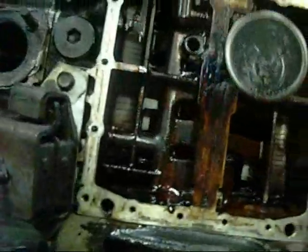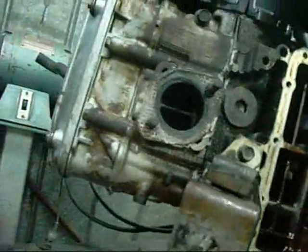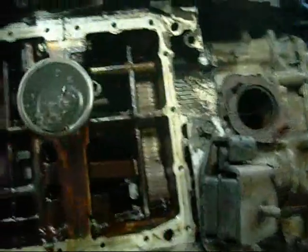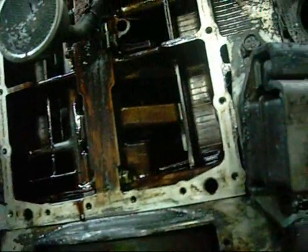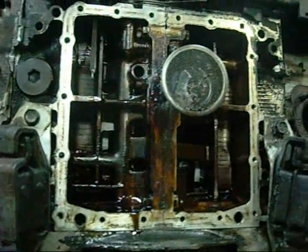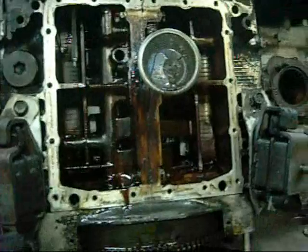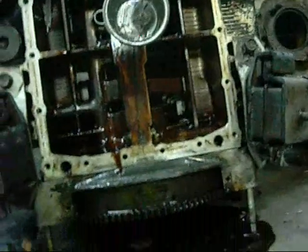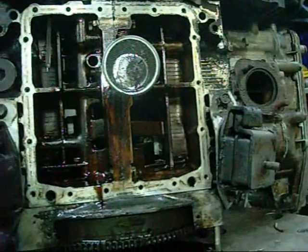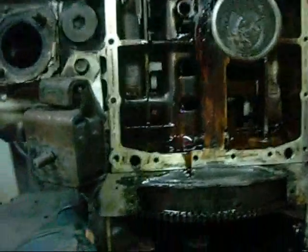Just imagine trying to do all the bearings and rings on an engine like this. You've got to take both heads off. Then you've got to try and split the crankcase, unbolt everything and try and get it back together without breaking rings or getting things stuck. I know the modern Subaru Boxer engines, you have to actually insert the gudgeon pins into the pistons after bringing the block together. Yeah. I'll stick to a straight inline 4, thanks.